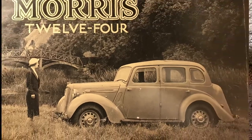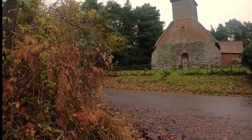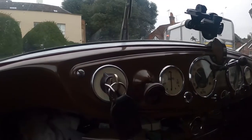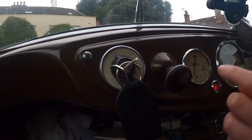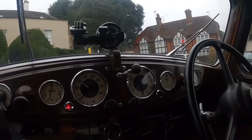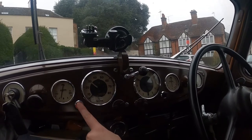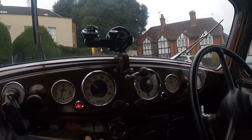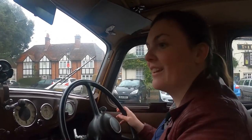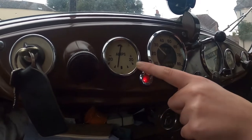But first, Kate needs to learn about the car. So talk us through the dashboard - let's start on the left hand side. We have the key. Turn it on and look at that dial and that dial - the petrol and the amps. That turns on the electricity. So that red light means the battery's not charging. If you're driving and that red light's on, that's bad. At the moment it's fine because the engine's not on - the engine charges the battery. The amps dial means the battery's discharging because it's on the minus side. When it's charging it'll be on the plus side.